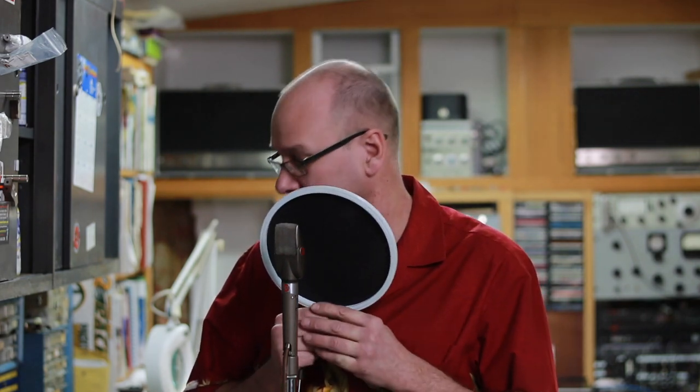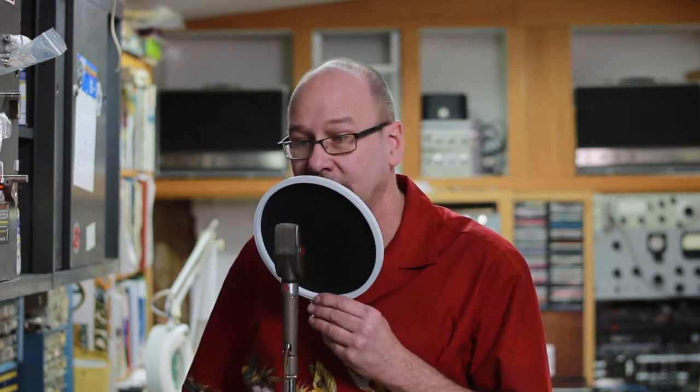With the music switch engaged at close proximity — about two and a half to three inches from the ribbon — it might be a little too loud, so turn it down slightly. Getting close gives your voice a deeper sound, and standing back still works well since it's a velocity mic. You can angle this little flipper up and down — that's why they call it the paintbrush, it looks like one. You can reflect off different items to get different sounds. Put some acoustic foam back there and it's a pretty versatile microphone. These things are very underrated — pick one up if you can, and if you don't want to do the modification yourself, send it to me.